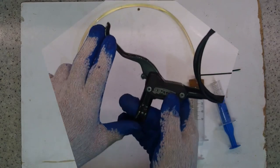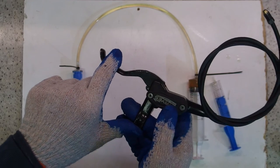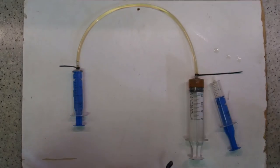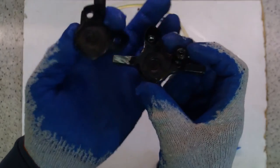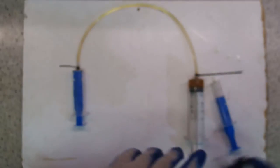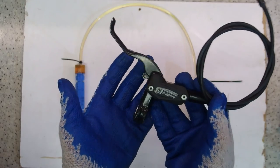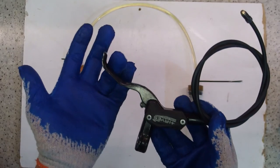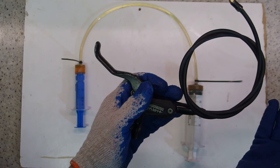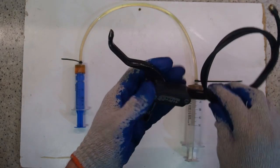How does this pertain to bicycle brakes? This is a lever and as I pull on it, the tip of the lever before the brake engages moves a significant distance — about 20 to 30 millimeters. However, the pistons in the caliper move out by approximately half a millimeter. So the mechanical advantage of the entire system is around 40 to 50 — quite significant. That's the point: mechanical advantage acts as a multiplier of the force you apply to the lever. If you're pulling at 100 newtons and the mechanical advantage is 40, the brake clamps the rotor with 4,000 newtons.